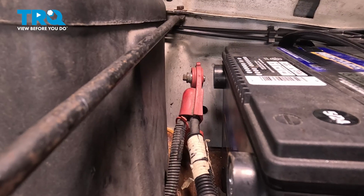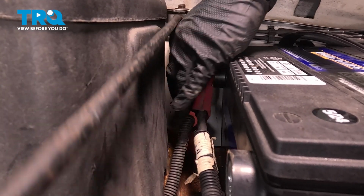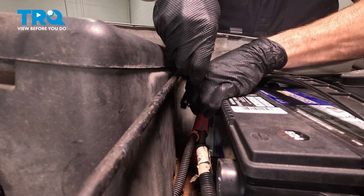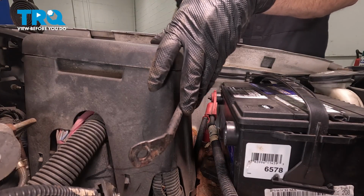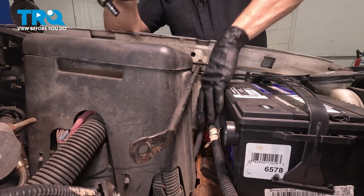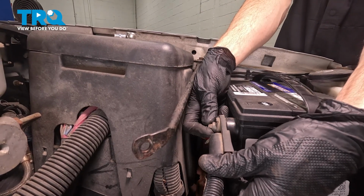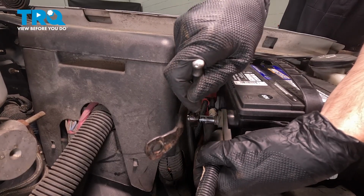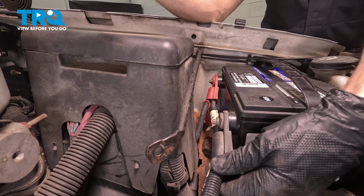Now let's reconnect our positive battery terminal. Let's get this in position. We can start snugging it up with our 8mm. Right there is bottomed out. Just take this a little bit further and then take hold of it, double check, make sure it's secure. This should not slide around. Repeat the process for your negative battery terminal next. Okay, bottomed out. Tiny bit further, a quick confirmation.